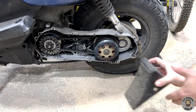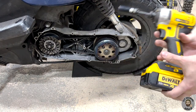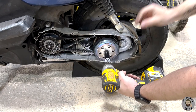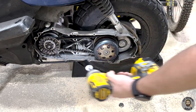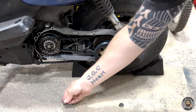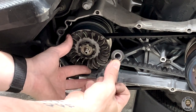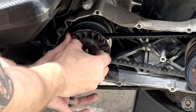It is highly recommended that you put chocks on either side of the back tire to stop the scooter from rolling. With a 17 millimeter socket on an impact gun, we're going to remove the two fasteners — one for the clutch as seen here, and secondly one for the variator. We will start by removing the variator, taking note of the placement of the various washers, nuts, star nuts, and thrust washers.